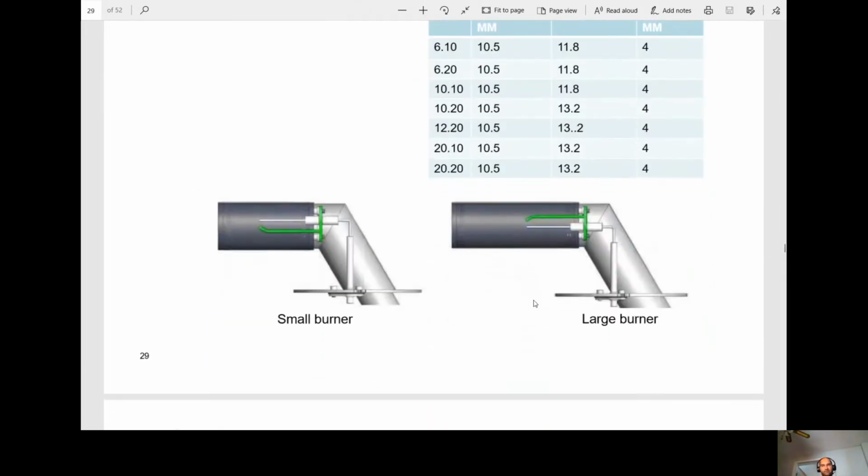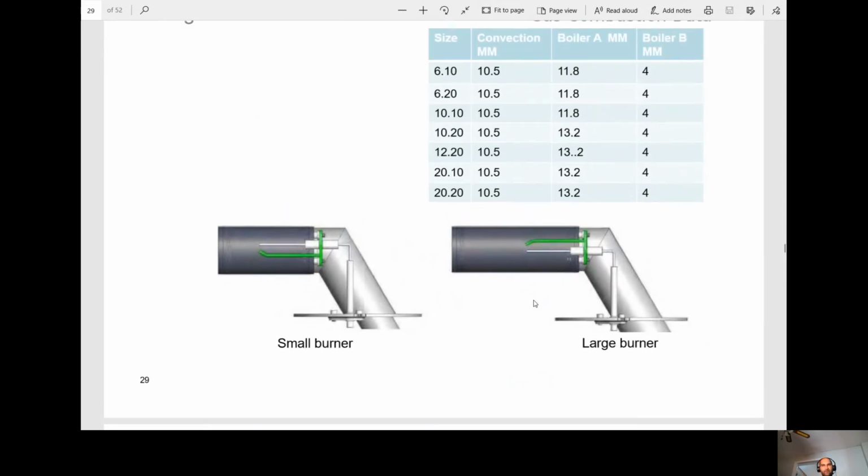So the igniter, there must be a gap of 4 millimeters for correct ignition. So this is the issue they're having. Once this little insulation piece would fall off or break off, that 4 millimeter gap would get either bigger or smaller, usually bigger, giving weak spark.